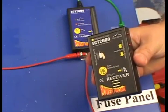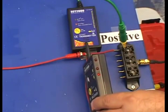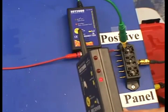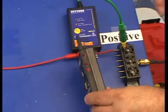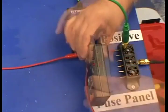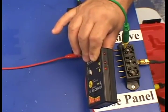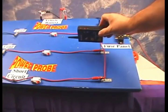Take the receiver and turn it on. When you first turn on the receiver it's in pulse mode — the closer you are to the circuit, the more rapid the pulse; the farther away you lift the receiver, the less rapid the pulse becomes. Holding the receiver parallel to your circuit in this direction, or flip it in this direction, the direction indicator shows you the direction to the short or ground. We don't advocate tracing the circuit in pulse mode — we'd recommend that you lock the reception sensitivity and then trace the circuit.